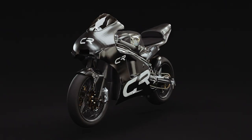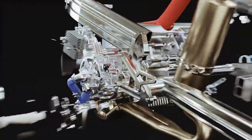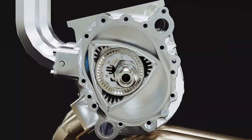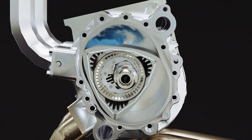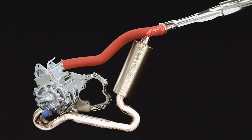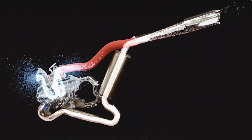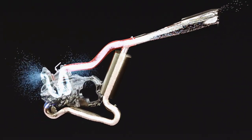The strength of a rotary engine is its power-to-weight ratio. It's obviously much lighter as an engine concept. There's only three moving parts — basically an eccentric shaft, which you can think of as a crankshaft. There's no stopping and starting like pistons going up and down — it's just a constant rotation. The exhaust system uses an exhaust ejector which cools the engine, using the energy from the gas flow to develop a vacuum, and it's that vacuum that pulls the heat out of the middle of the engine. That's why the exhaust system is different from anything else.